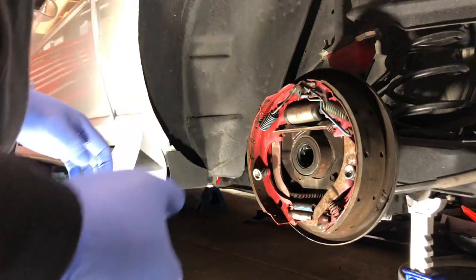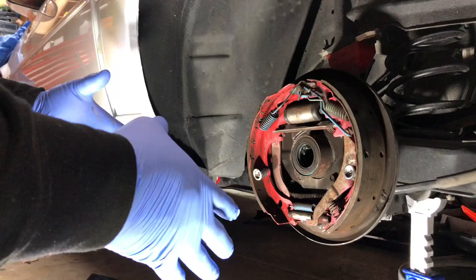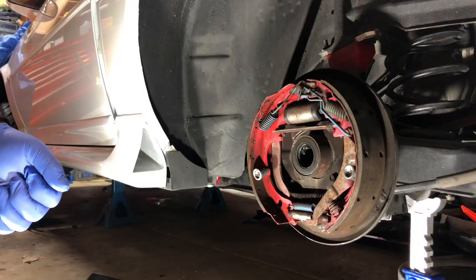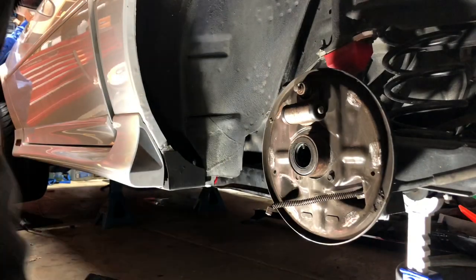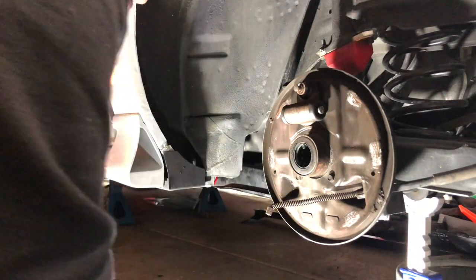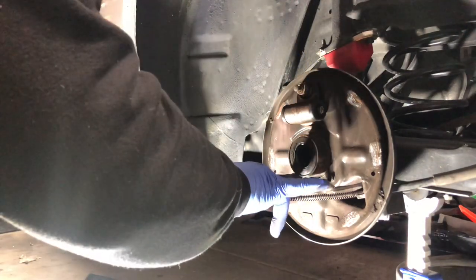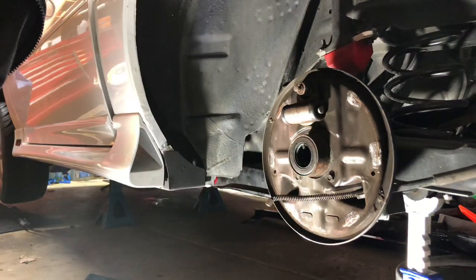The next thing you've got to do is remove all this brake hardware. It's something I've never done without the axle in the way, but I think it's gonna make things a lot easier. So once you've got all your stuff out of the way, this is what you're left with: a little brake cylinder there, emergency cable, and this nut here. Basically we've got to get these two bolts out plus this nut back here and that whole thing's gonna come off.